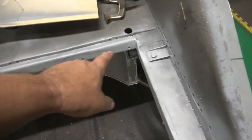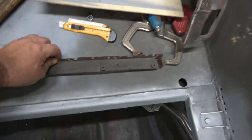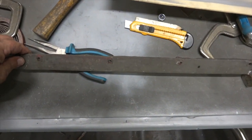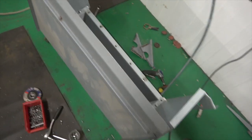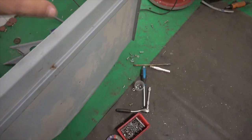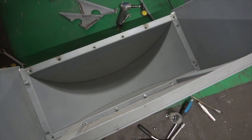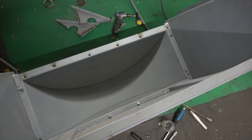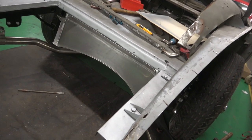This has been completely brand new made. The original one was here and as you can see it's quite badly damaged and deformed - it just wasn't worth it, so we made a completely brand new one. And there's the battery box. Again, this isn't welded yet; none of this is welded - it's just got self-tappers in at the moment. You can see here where the bolts go in. Basically the two sides and the bottom is the only thing that goes in, and this spare wheel well goes in afterwards. It goes in after the car's painted, back on the chassis, and you put it in separately. Because as you can see, it goes into that space there, into that hollow where the tank is - that's why the tank is shaped like that.